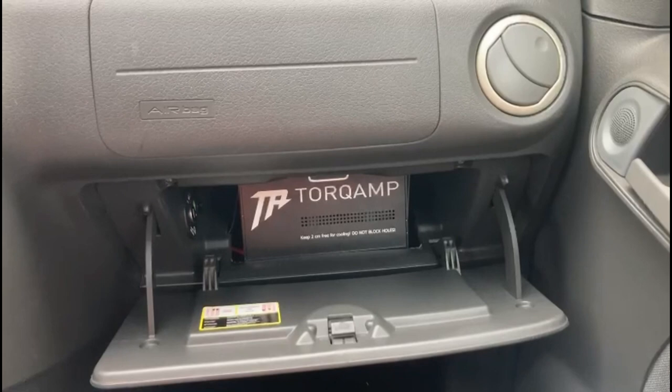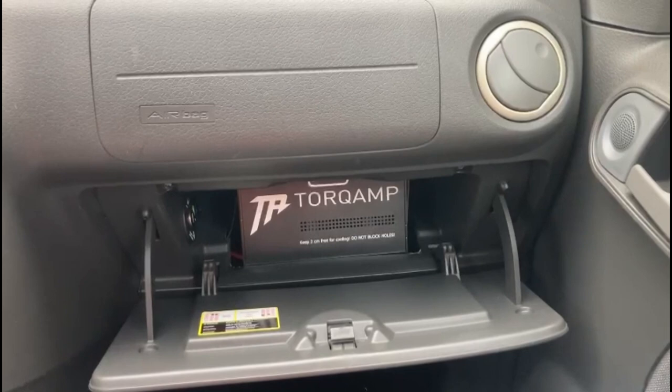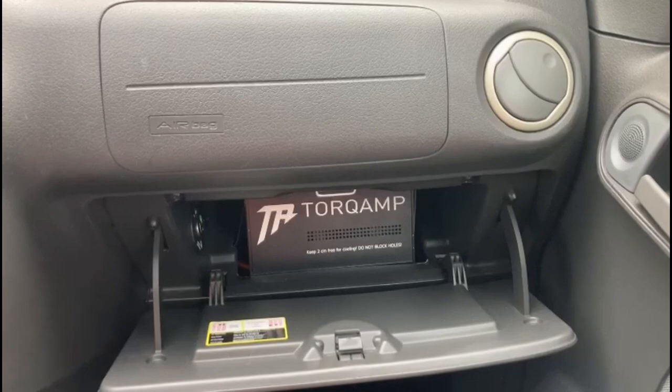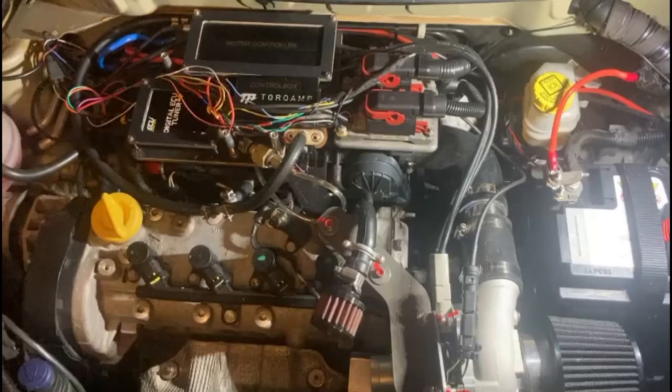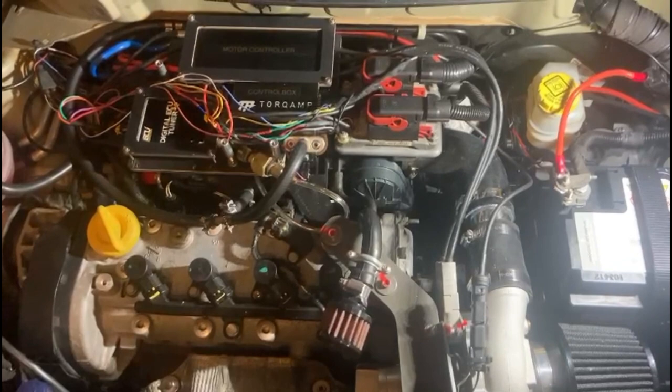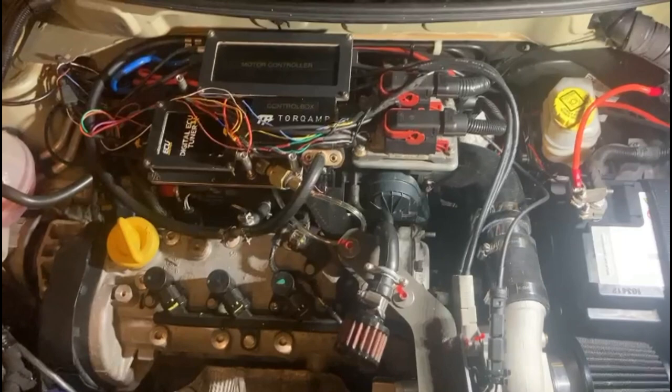I initially had some boost anxiety. In practice, I learned that during normal use these batteries are always fully charged. This will only be a problem when driving at full speed for a longer time — on the German highway or, for example, on a racing track. During normal driving, the 5 kilowatts needed to boost the air is collected back into the batteries.